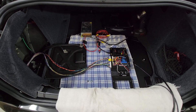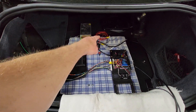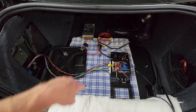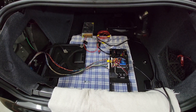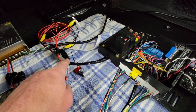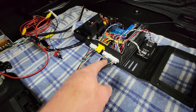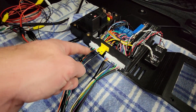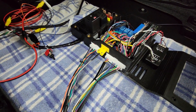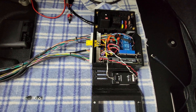I've got the wiring pretty well wrapped up, just a few key terminations remaining — those are the power wires. Right now I've got alligator clips going to a 12-volt supply, serving essentially as the battery would. These are the four harnesses coming into this Arduino box: the power connectors, a key-on trigger wire from the vehicle as a wake command, and then an 18-pin and a 24-pin Molex connector. I've still got some free terminals, including relay outputs and MOSFET PWM outputs that are unused, and this is the type K thermocouple output for the EGT sensor right before the turbine inlet.